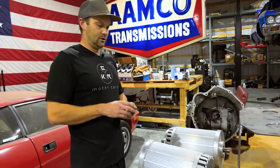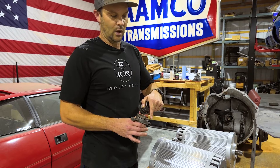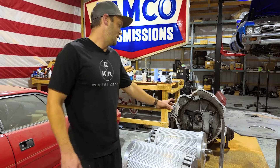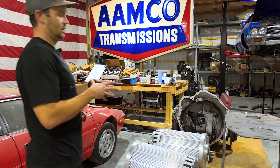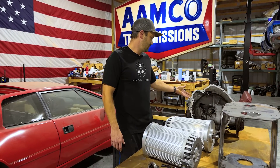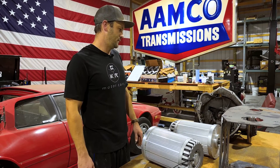So we're going to have to either use the stock Lotus Citroen throwout bearing and somehow get it a little bit wider to cover more of that, or we've even thought about doing one of those throwout bearings like you see on modern cars where it doesn't even have the slave cylinder separate — it's all built in, and when you hit the clutch it expands and opens up. Do some measuring and see if we can get something to work there. It's always easier to take out all those extra moving pieces, so that may even be a better overall option.